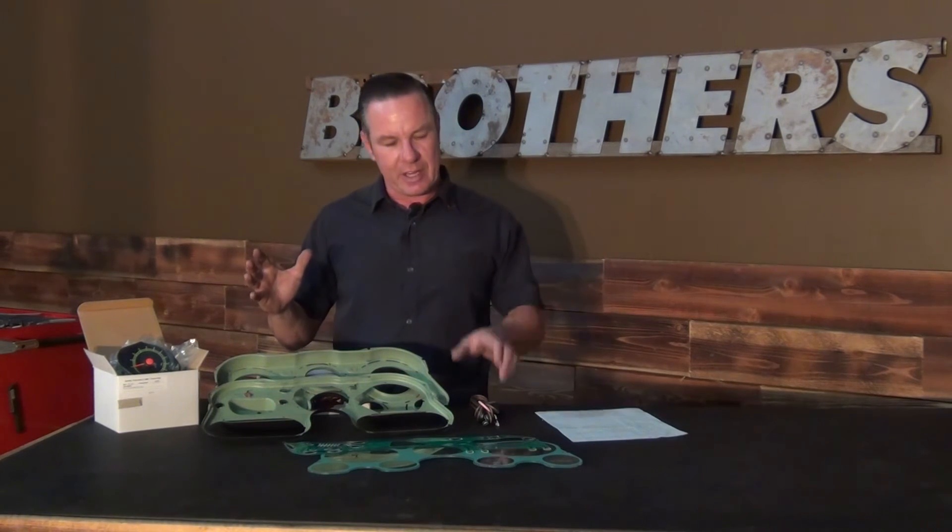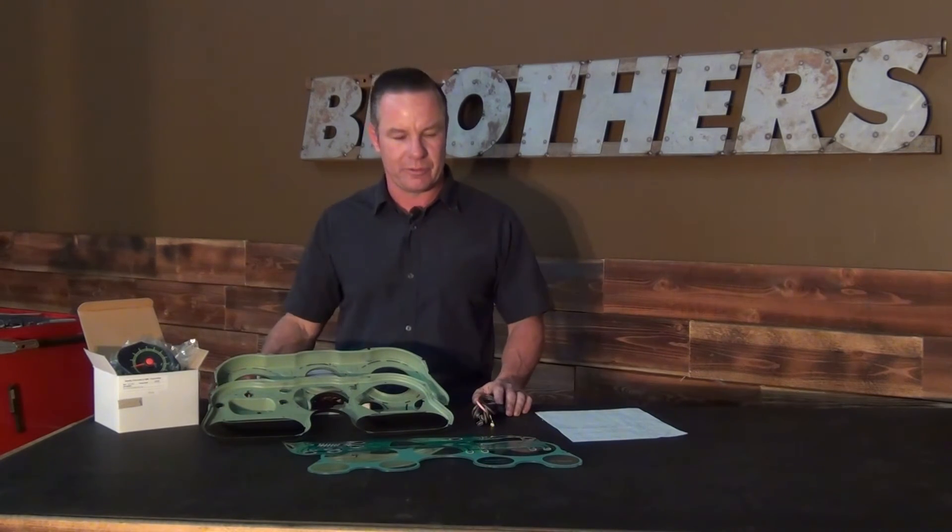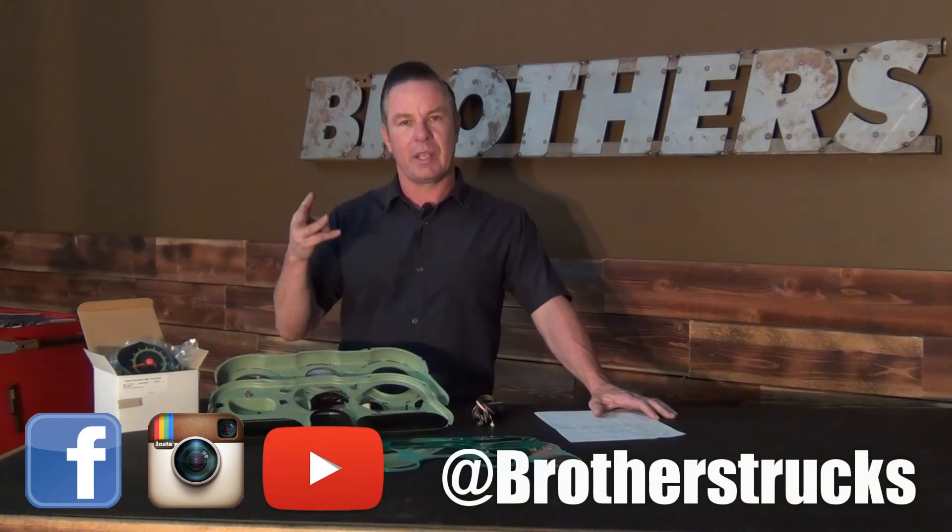As you can see, that's an easy modification — no problem doing it with simple hand tools. Easy to route the wiring; they plug right into your factory fuse block as well as going right through your firewall. This is an easy installation depending on how long it takes you to get the dash out, which is just one plug and an oil pressure line. Once you get the dash out, this installation is probably going to take you an hour and a half to two hours at the most, depending on how much restoration you do to the other gauges inside your dash. Thanks for watching and don't forget to check us out on Facebook, Instagram, and YouTube.